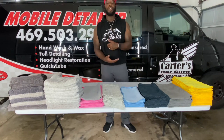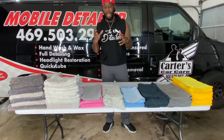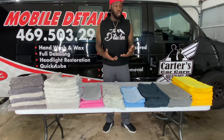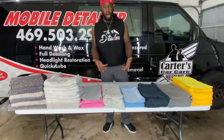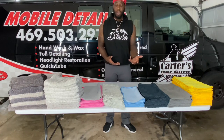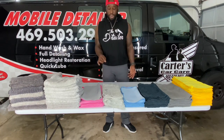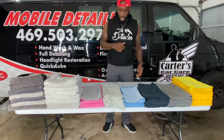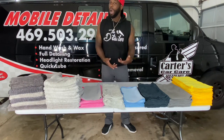And a lot of these cars out here today, they have all this micro marring inside of the paint. It's due to people using the wrong kind of towels on the paint, not knowing what kind of paint your client has, or this, that, and the other. So a lot of people ask, what's causing all these scratches on the paint? Well, how are you drying your car? How are you washing your car?